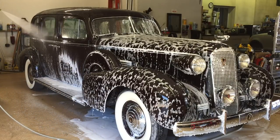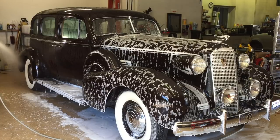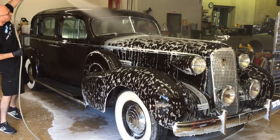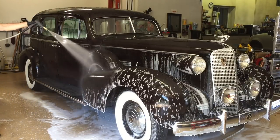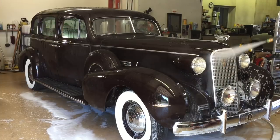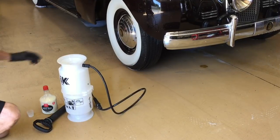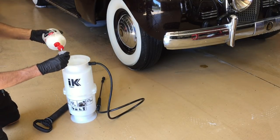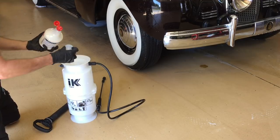Using a power washer on a car like this is an absolute no-no — especially if you don't know the vehicle. This car is here for restoration; the inside is done and so are the seals and rubber grommets. For gentle rinsing, even if you want to do a contact wash, it's probably better to use a waterless or rinseless wash. If you must do a hands-on contact wash, use a hose — take the tip off and gently rinse with free-flowing water. Stay away from the seals and windows if you don't know what you're dealing with. This one is sealed better than my car, so we're good to go. I just back off a couple feet with the pressure washer to bring the pressure down at the point of contact.